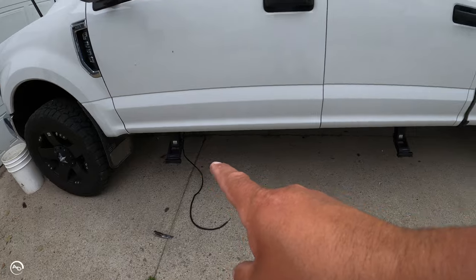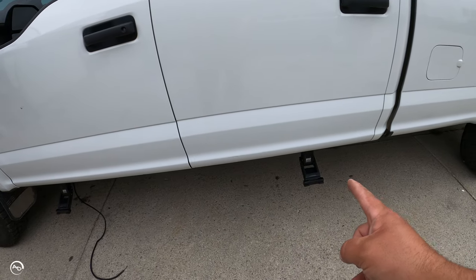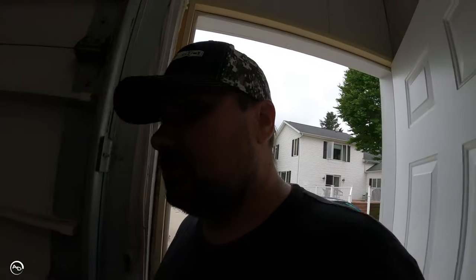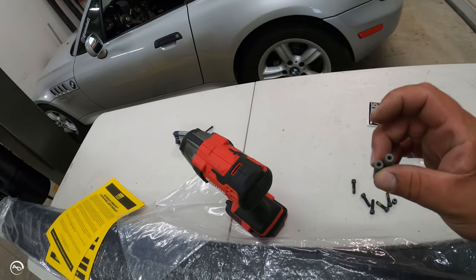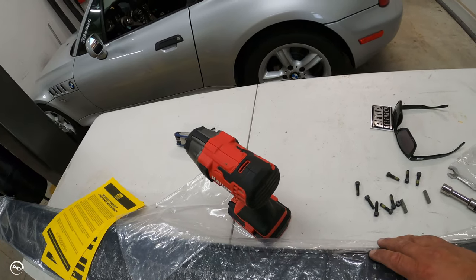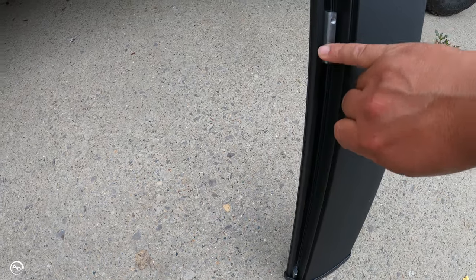So under the carpet, through the kick panel, up to the top. The next step is not the lights but putting the running boards on. Once you get them on, measure from the back 11 inches — that's where it's going to be. If you've got the crew cab four-door like me, you don't have to cut these. If you've got the super cab or a regular cab, you cut them and the measurements are in the instructions. Crew cab is easy. These are the bolts — and hey, those are the splice connectors I was supposed to use for the OBD2 port. I just looked in the wrong hardware pile!